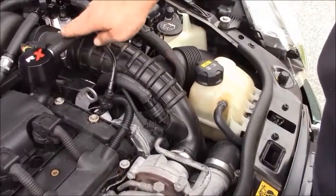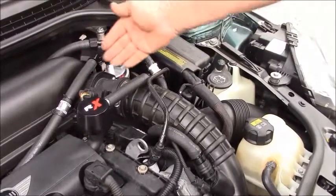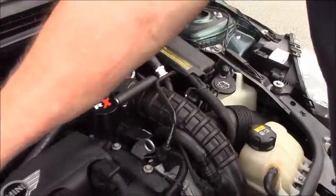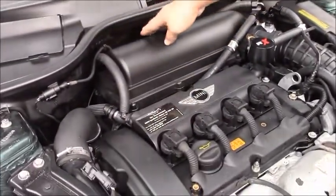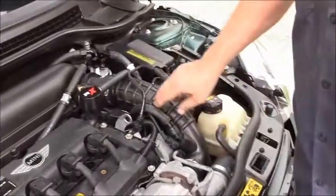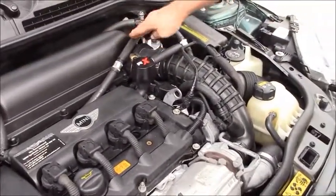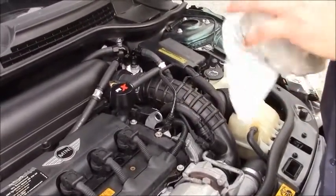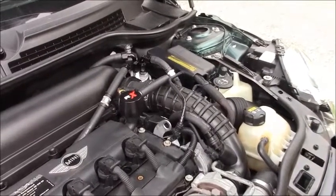We never want it to backflow. We always want clean, filtered, mass airflow metered air coming into the crankcase, and your foul, contaminant, vapor-laden air going out. And these are our two suction sources, non-boost, boost. So we now pull vacuum at all times. We don't have any oil leaks because of crankcase pressure.